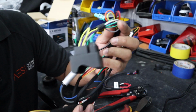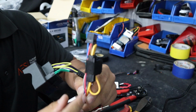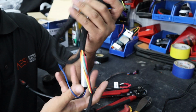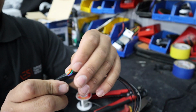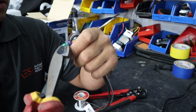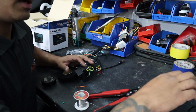Okay, that's the wiring side of things pretty much dusted, so that's all soldered. Now if you just buy the step 2 Alpine plug, you can just make it plug and play, but I like to hardwire it, it's neater, less plugs. This will come with instructions. For Alpine, you cut green, like that, simple. Disregard the other 3, tape it up. All right.